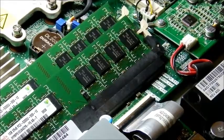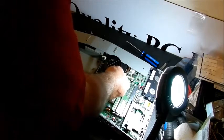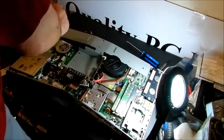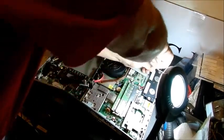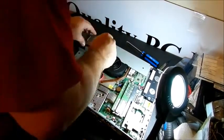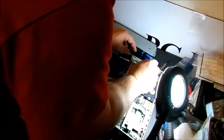We're aiming to get to the wireless network card which is over here — there's another card there too, but that's the wireless network card. To get to it we have to get this top plate off. There are one, two, three black screws — we already took black screws out of the hard drive, so you've got to push down and really turn it because it's on there good.